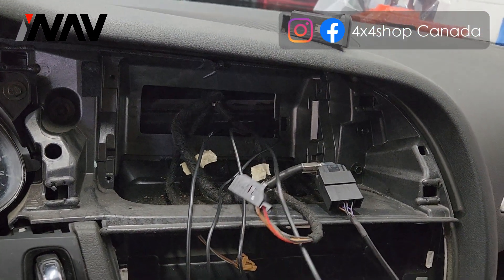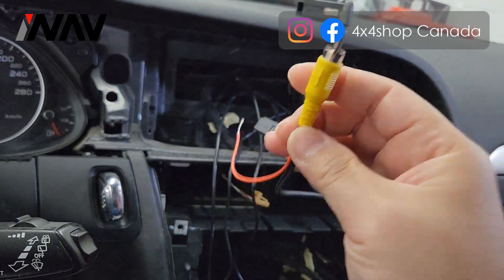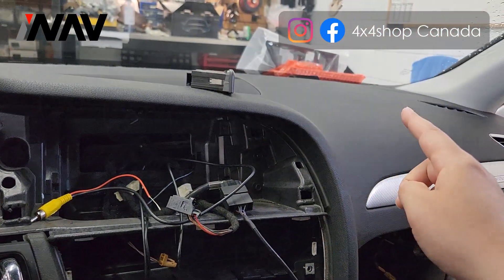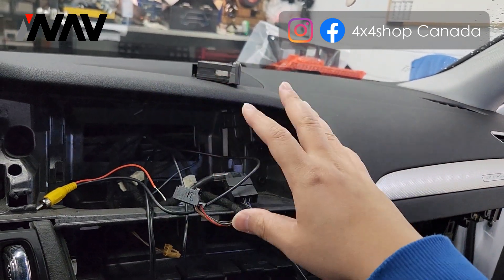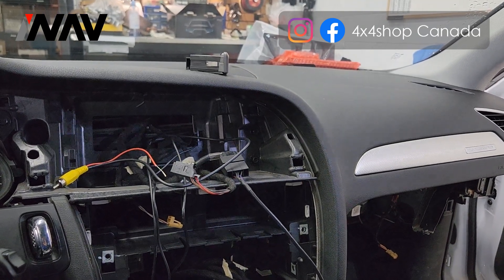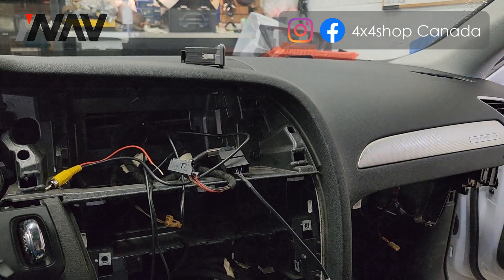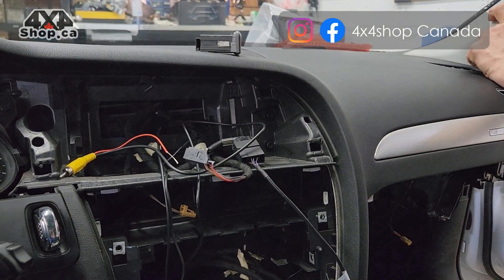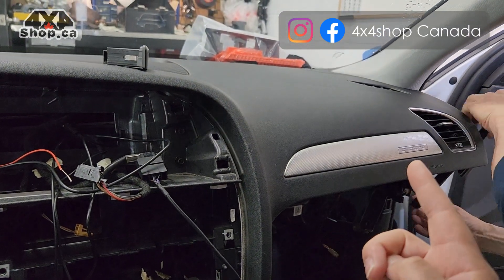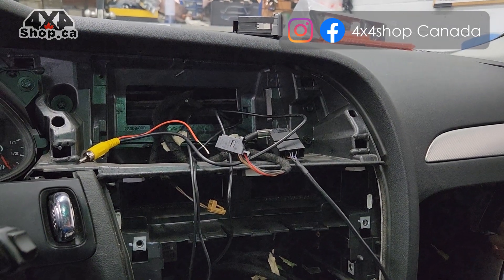If you're planning to add a backup camera, this is the wire you run from the back to the front — the orange wire. Leave it on top. For the 4G antenna and GPS antenna, it's better to leave them on top of the dashboard away from the Android screen to avoid signal interference with the CarPlay signal. The Wi-Fi and Bluetooth antennas are built into the Android screen. You can leave the GPS and 4G antennas underneath the glove box, near the B-pillar, or on top of the dashboard.